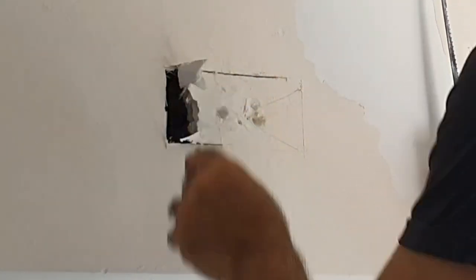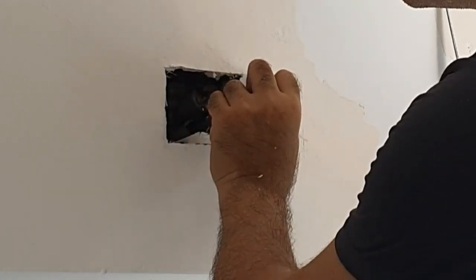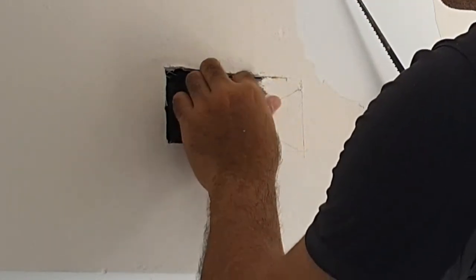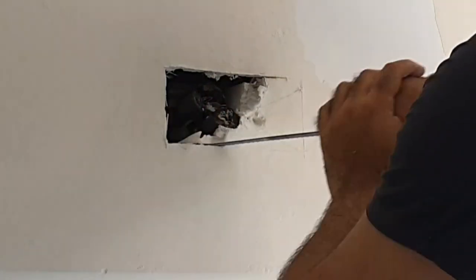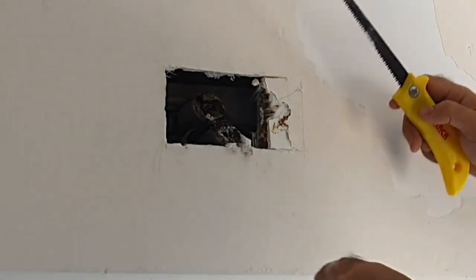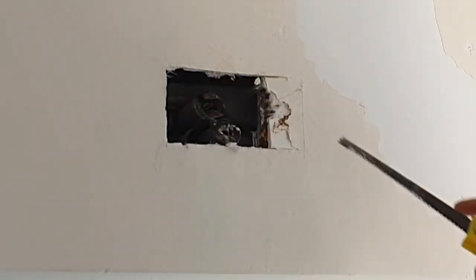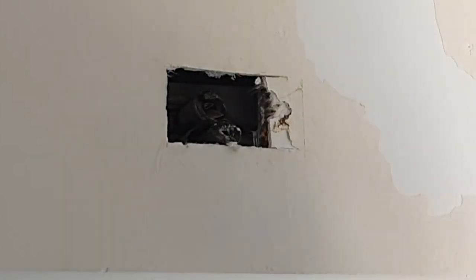Let's see what's inside. That's the old air-conditioned piping. There are some supports over here — I see what they did. There is a steel bar here, so I can't go any further. That's going to be the end of our patchwork. We'll putty this up, probably use a bit of fiberglass tape. But we have to get the pipe shortened — I'll bend them in a bit so that I can fit my California patch right there.